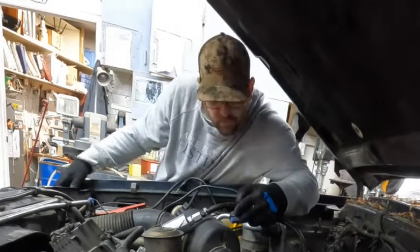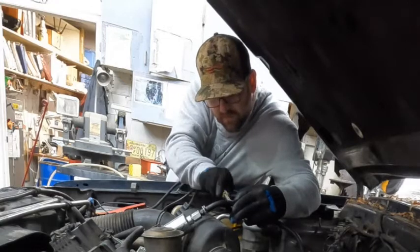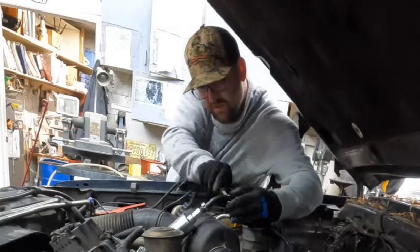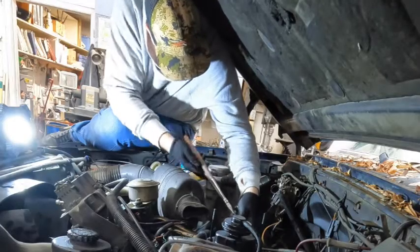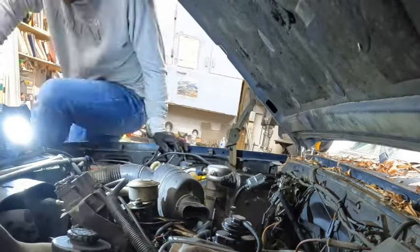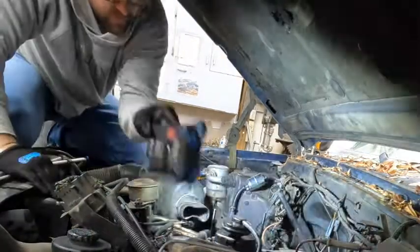And of course, the new fuel pump fought me every step of the way. The old fuel lines were hard and not quite big enough, so I had to take some needle-nose pliers and wrench those apart. Just a lot of fun working on these old trucks. I'm gonna have to climb on this fucking thing again. I need better leverage.